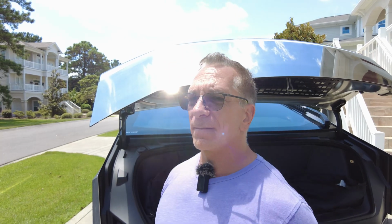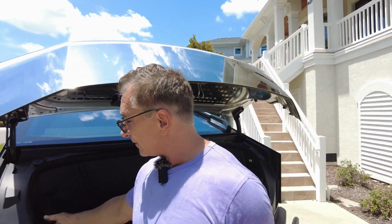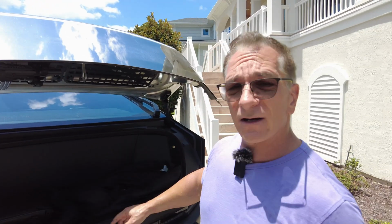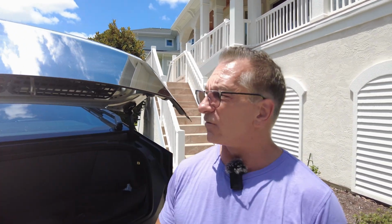Then there's a third one, which you're not gonna use, that's a green one, that's the Tesla linear interface module, something like that, where it actually controls the lights. So Tesla has its own controller for it. But basically you got those 3 wires right there. So basically you attach those wires, you're gonna fish that wire underneath and connect all your lights, and that's it. And then you can just have the power set up where you're running the lights while your truck is on. When it's off, it'll shut off automatically. To me, that sounds like the best way to go.